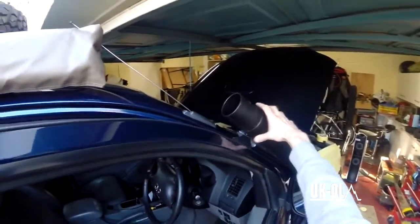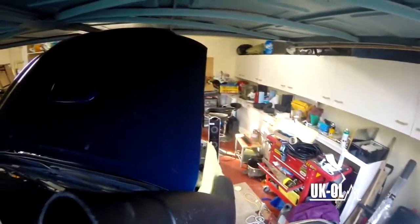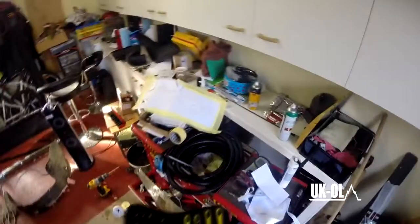Check for alignment up and down, make sure your Snorkel body tube lines up nicely in the hole, it's not binding on anything, it's nice and square in the hole, and it lines up about where it should on the A-pillar as well before you go any further. Then you need to deburr.